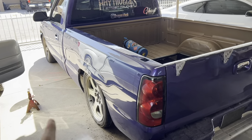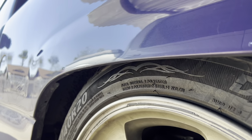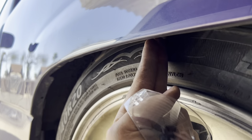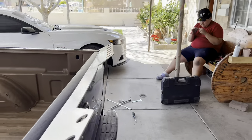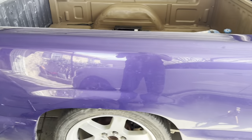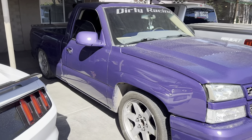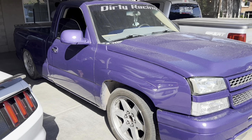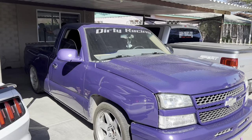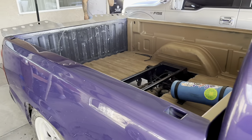When you get eBay flip kits, or your flip kit is just damaged or worn over time, your diff will start to shift. There's like two fingers of space between the tire and the fender on one side, but on the other side it's basically sitting right on the fender — you can't even fit a finger in there. Make sure to check your flip kit, make sure the strip isn't cracked, and get a good brand flip kit. This truck is finished up — my boy Brian PBNJ runs a pretty cool JDM-style truck.